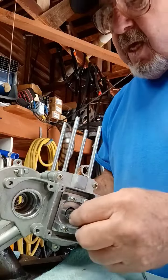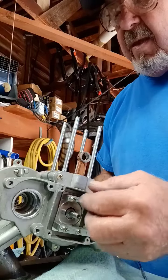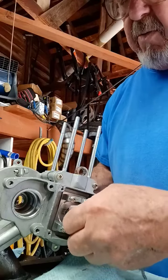One thing I'll throw in as a footnote: I've noticed people trying to modify the inside of their case to get more flow. I looked at one guy's pictures and noticed that on the back side back here, he had ported it all out for maximum flow coming up the back side. It looked awesome — there's only one problem: the engine doesn't turn that direction.